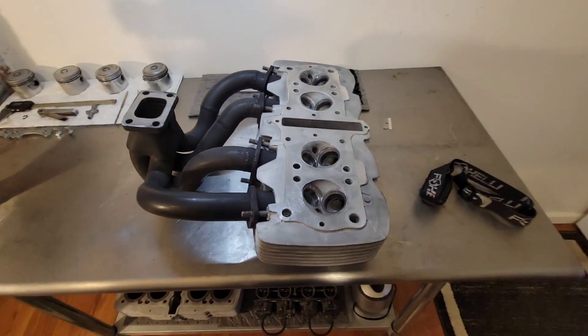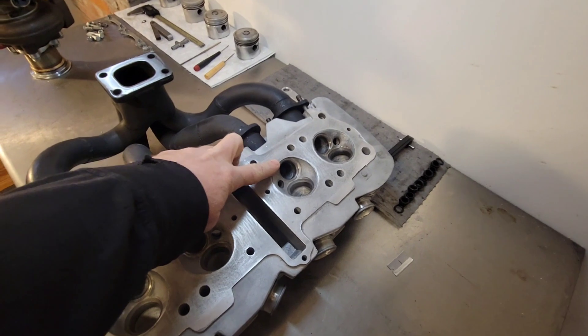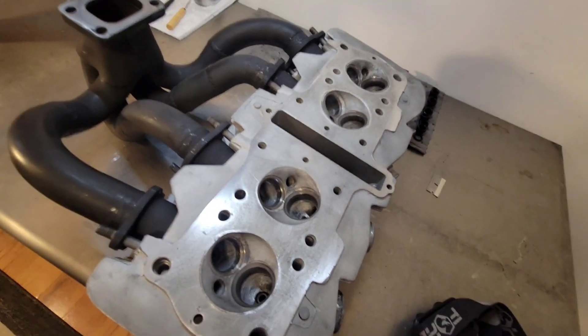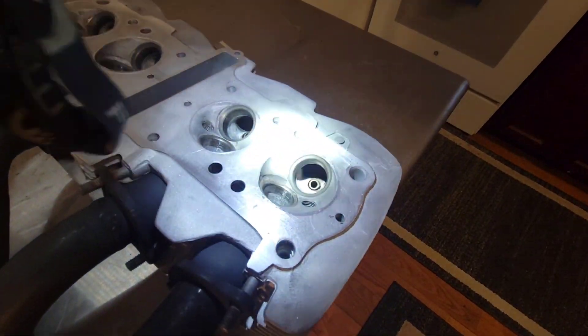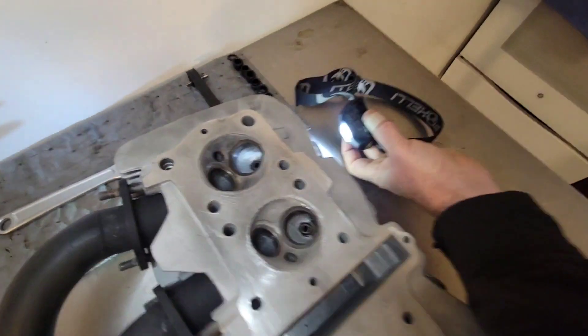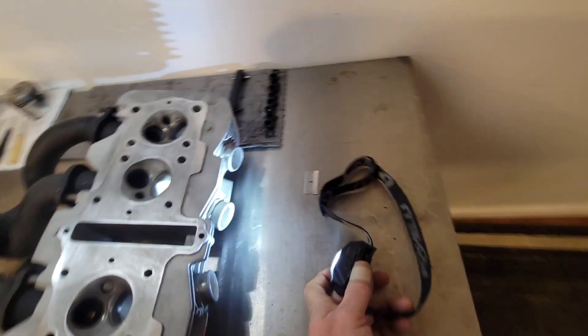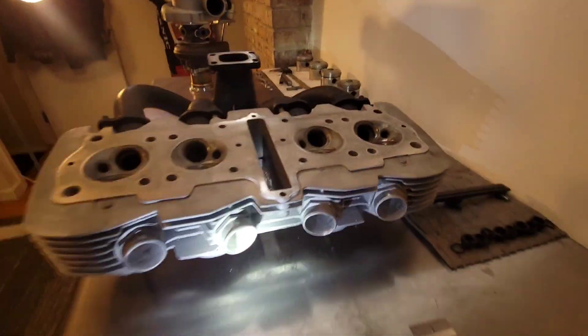If you have to take it back off, clean it with some brake clean, hit it with new copper spray and you're back on track. Cylinder head looking awesome. Still waiting to gather funds to put some new Kibble White valves in — the new Kibble Whites will get lapped into these seats. The seats and valve guides are looking awesome. On the intake side I ported it a lot just to get them to flow — they're going to flow that boost into the cylinder and it's going to work out awesome. I've got my golf ball dimple too — I don't like it 100% smooth on the intake side. I like it to ripple and dimple and keep that fuel in suspension. The more you keep fuel suspended in the airstream, the more that gets into the cylinder, the more bang you get.